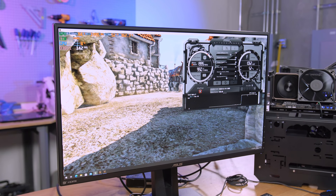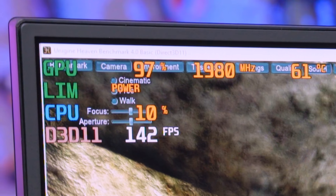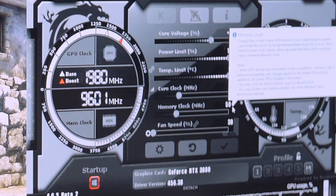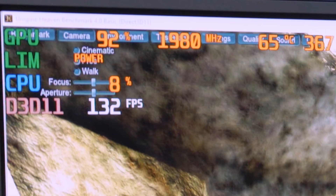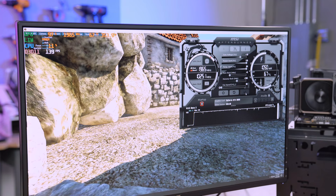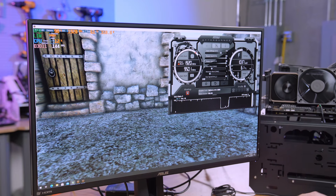I'm going to save this profile and show you something with Heaven. It's important to remember this is error-correcting memory, so the way you'd know your memory was acting weird in the past is you'd start getting crazy artifacts — triangle shapes, pinks, blues, crazy lines and flickering. That's usually indicative of memory issues. If I go plus 100 on the memory, watch it dip when I apply it but then come back. At plus 500 on the memory, once again nothing is really happening — a 500 MHz increase and no visible effect.